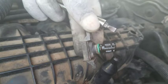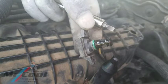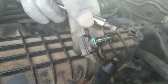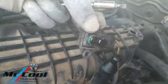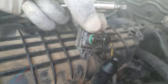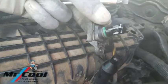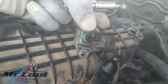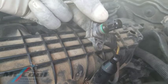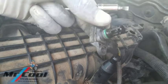Gently — there is a seal there. That is it, okay, just like this. You can see there is a lot of oil right there. The presence of oil on the mass airflow sensor is significant. This kind of mass airflow sensor is different from the traditional ones we know — it's more like a manifold absolute pressure sensor. Most of the pictures I'm seeing on the internet concerning the mass airflow sensor for this car are not a match. The presence of oil on a mass airflow sensor like this is going to shield it from doing the right calculation — the right information the ECU needs.